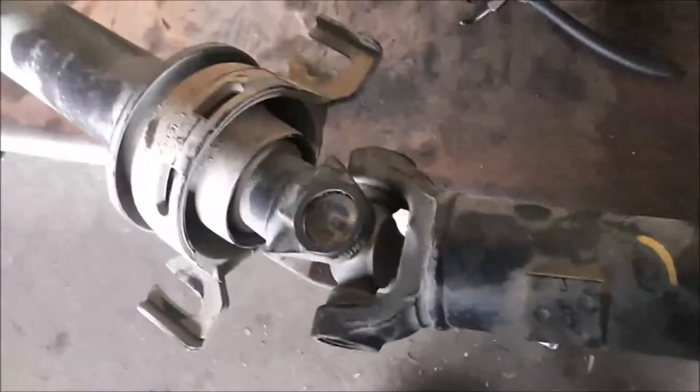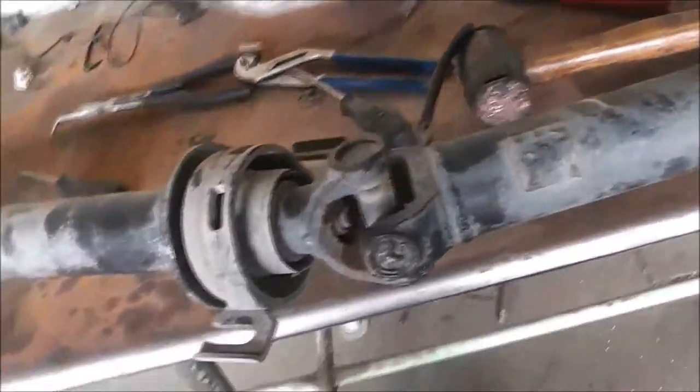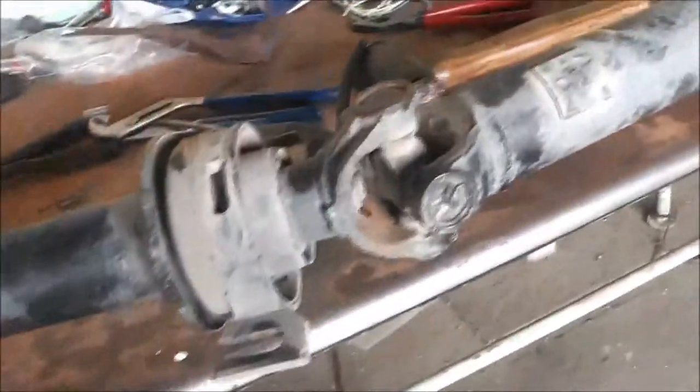I've already removed the circlips for the uni joint close to the cross there, because there's plenty of videos out there showing you how to do that, but I've only done the two halves, or the half required to access that nut. Not easy, but I'll have a go at showing you removing the cross. All I'm going to do is use the old trusty copper hammer.